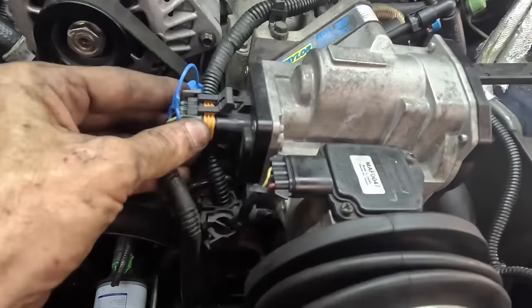We got loads and loads of oil out of the system. However, at this point, what I'm gonna have to do is a series of drain and refills on this engine in order to get all that nasty out of the system. Plus, it's all water. So I'm gonna drain all that out, and then we're gonna refill this with the proper coolant mixture. As of right now, everything's piping hot, 210 degrees, so we're not gonna drain the coolant right now. I'm gonna let this thing cool down. I'll probably do it in the morning when it's at a very stable and low temperature. I don't wanna burn my flanges.